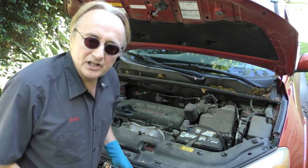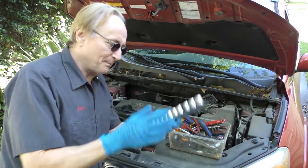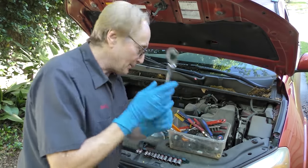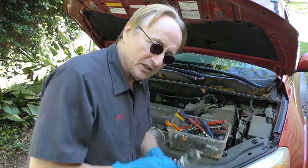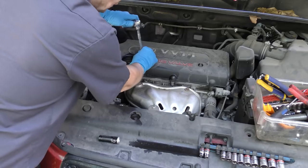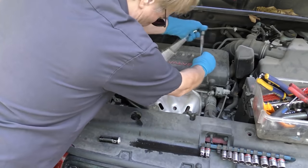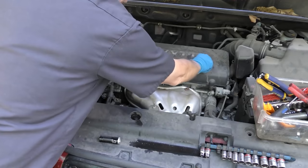It's a relatively easy job. I just got a few of my tools in this plastic case — basically you just need the sockets, a ratchet and a little extension. The first thing we're going to do with the 10mm socket is take off the beauty cover. It's just in the way and really doesn't serve any purpose other than making it more annoying to repair.